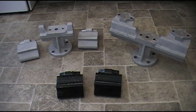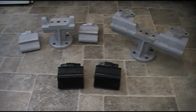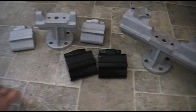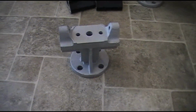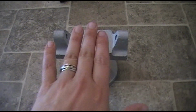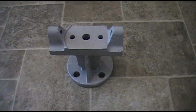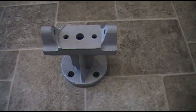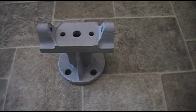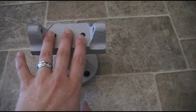Okay, so the low-profile manifolds are, in my opinion, the most interesting and are the primary focus of this video here. Alright, so the low-profile manifold started out in the 1960s with this. This is a low-profile 3-chime manifold. Now, despite what some may tell you, these low-profile P3 manifolds are not rare at all. They are super common. Southern Railway and NS had thousands of these things. They had pairs of low-profile P3s on each end of a lot of their GP units. The point of the low-profile manifold is to spread the horn out a little bit wider so that it wasn't as tall.